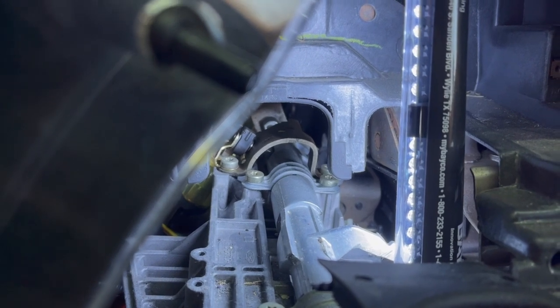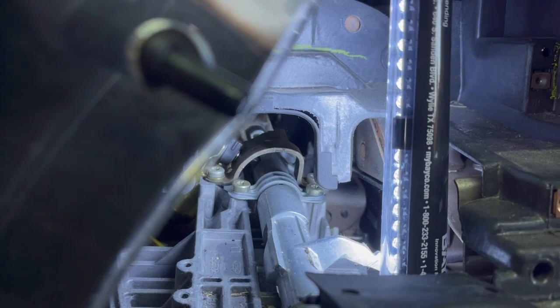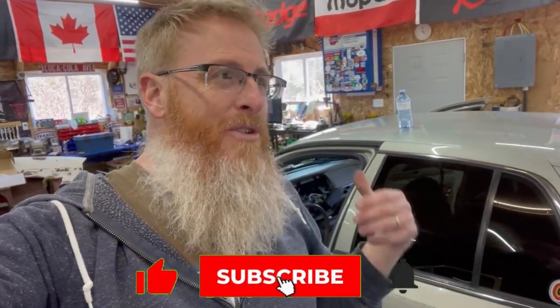Unfortunately, we've come this far and everything is still loose on this column. So if you're in this position and you've tightened up all six bolts and everything is still loose, you probably need a new shifter column. Only one time in 13 years of selling and working on cars have I ever had to replace a shifter column, and that was on a Ford Ranger — very similar setup. A lot of these Fords use aluminum shafts and hold-downs, and over time they just happen to get loose. So what we're going to do with Grandma is absolutely nothing — we're not going to replace the shifter shaft; we're just going to put things back together. That is how you do it 99% of the time when you have a loose shifter.